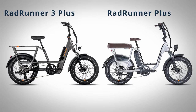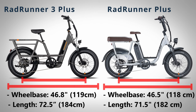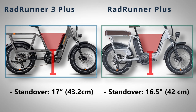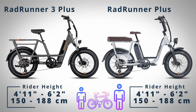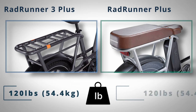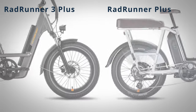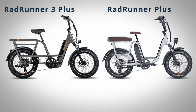While it shares a similar overall shape as the original Rad Runner, the frame has been completely tweaked and redesigned. The down tube has been straightened, and there is extra reinforcement added to join the front half to the back end of the bike. The 3 Plus and the original Plus share similar overall lengths and wheelbase measurements — an inch or less difference. The standover height is relatively unchanged, only gaining about half an inch, so the recommended height range remains the same: 4'11" to 6'2" for both bikes. The weight is similar as well. Rad lists the same 120-pound max for the integrated rear rack on both bikes, but the redesigned frame has upped the total cargo capacity to 350 pounds on the new version, versus 300 pounds on the original Runner Plus.